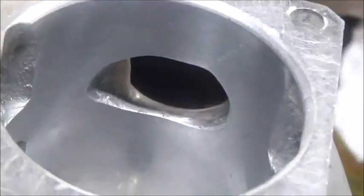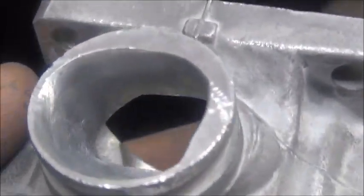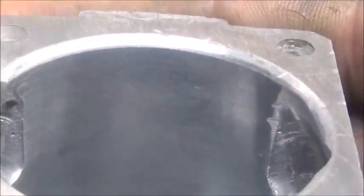Finish on it turned out really nice. Had to lower the intake a lot, but I've done some further or worse. But again, really nice finish. Everything turned out really well. You can see that's a Nikasil coated cylinder from the Duke. It's got a pretty nice dang finish on it for aftermarket. And I don't think this was very expensive either. It's a 44.7 big bore top end.